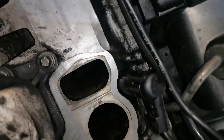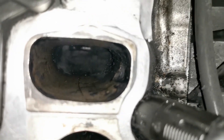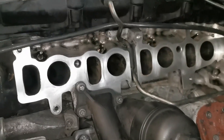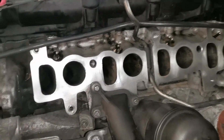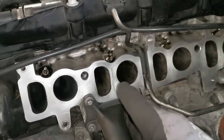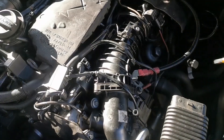While on cylinder two, I tape off cylinder one. Here's a look at the vast improvement we have when doing this cleaning — you can see there's a huge improvement from where we started to where we are. Then I focus on the cleaning before I reinstall the intake manifold and use 3M Scotchbrite to scuff up that area and have it ready for fit back.